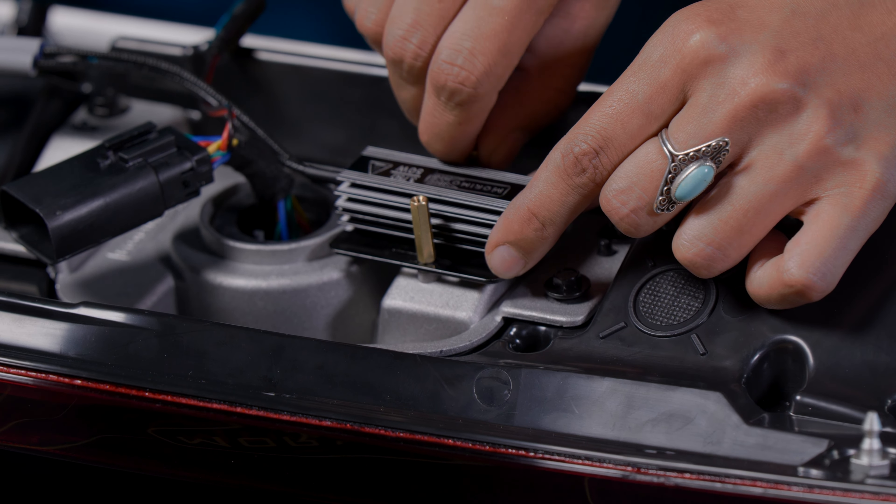For the 2020-plus halogen without Bliss, you'll be using both resistors — the 7.5 ohm and also the 3.75 ohm — along with both standoff screws and the standard smaller screws. You'll also be using the adapter harness using plugs one, two, and three. Next up, for the 2020-plus halogen with Bliss, you'll be using both resistors again — the 7.5 ohm and the 3.75 ohm — all the hardware including two standoff screws and the standard screws. You'll be using the adapter harness using connectors one, three, and four.